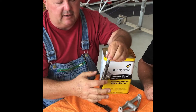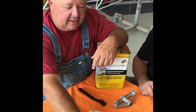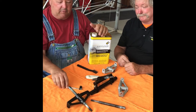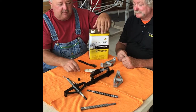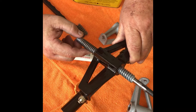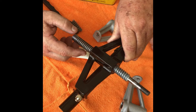Just run it up and down to clean that grease out — it takes a few minutes at your annual but it's the best thing you can do. Get that grease and grit out of there, then apply a new coat of lithium with a simple acid brush. Because you don't want what you see here — this thing is just slap worn out with up and down play, and now your trim doesn't work right.